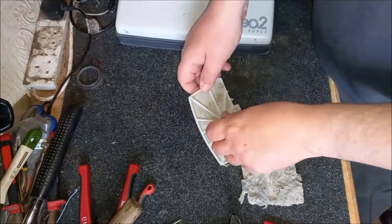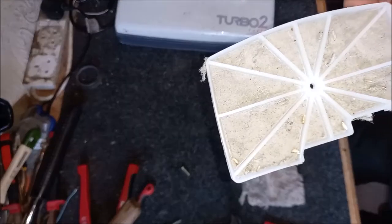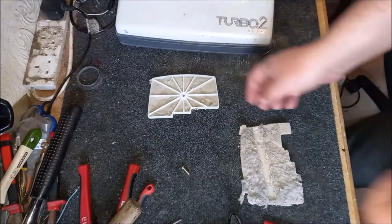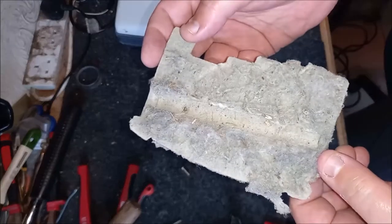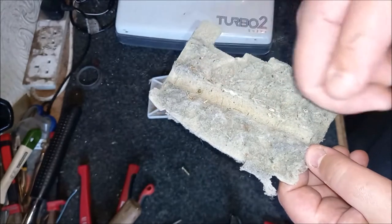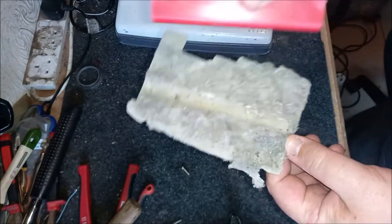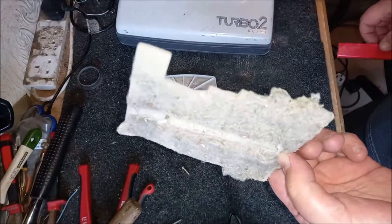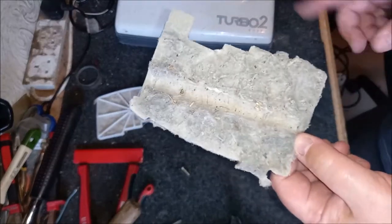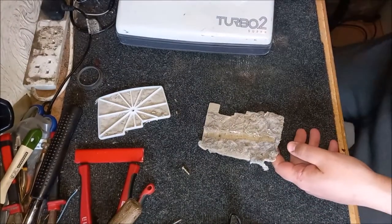It's not very pleasant — we can see the carapaces of the little moths that have been living in here. And you can see the build-up on the top filter — there's a ridge where the bag slide was sat in, and you see just how thick that dust is. I think we'll just give this a clean up; we'll replace this one, the other can be washed and used again, and we'll give this one a vac off and reuse it.